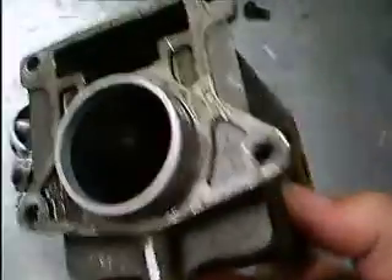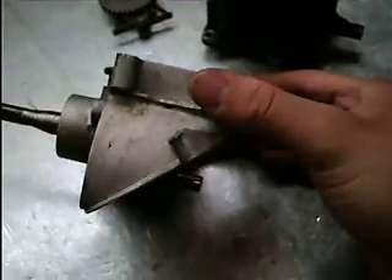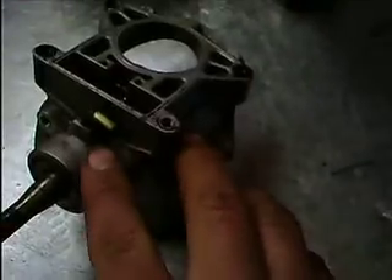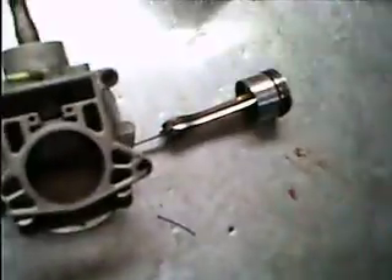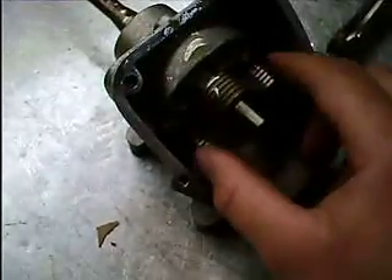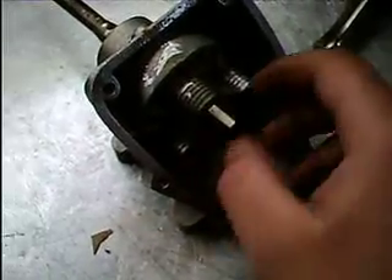Same thing with the cylinder — it's nice and shiny and smooth and clean. The case might be a little bit of a problem. Here's the breather right here — there's a little tube that hooks on here and has a little filter on the end. There's the gear down there that drives the cam. The cylinder attaches to these two holes, and it's got a little counterweight there. It's a pretty nice design. The cover for the case is this little plastic thing right here.